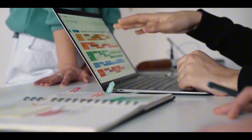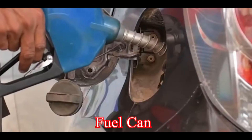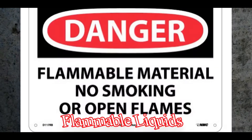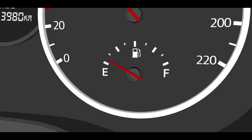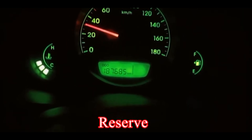Here is how to use the Chevron Techron Concentrate Plus to clean your fuel injector. You will need the Chevron Techron Concentrate Plus cleaner solution, a funnel, a gas station or fuel can if you are topping off at home, and gloves and safety glasses are recommended. Before you begin, please note that fuel system cleaners are flammable liquids, so avoid sparks or applying the cleaner close to an open flame. Step 1: check your gas level. Ideally, you want your car to be near empty or less than half a tank before adding the cleaner. If possible, let your gas be on reserve — this ensures the cleaner gets a good concentration in the fuel.